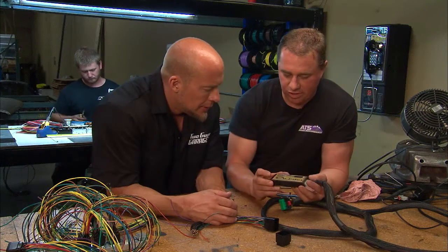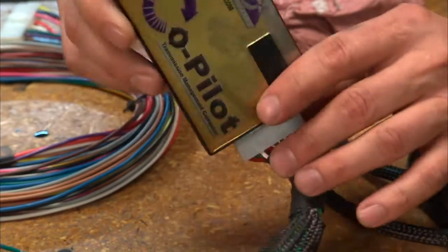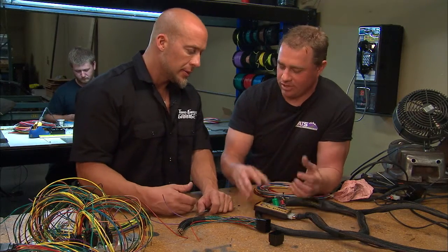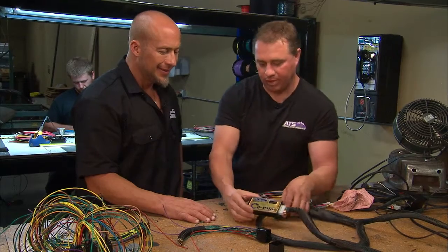The real secret to the co-pilot is that building a good tranny is only half of it — you have to be able to control the tranny, you have to tell it what to do. The co-pilot will control and give you some input. It controls torque converter clutch application and it controls line pressure. Line pressure is the clamping force in the clutches, and the torque converter is the engagement from the tranny to the engine. When you bring that whole package together with the co-pilot, it gives the end user the ability to control how much power goes through the tranny when it upshifts, downshifts, and brings the converter in. It's just kind of a full package.